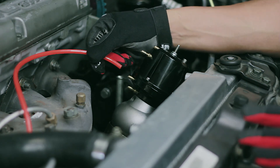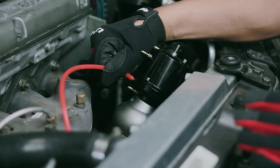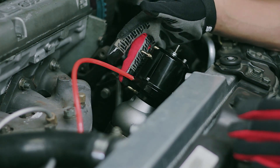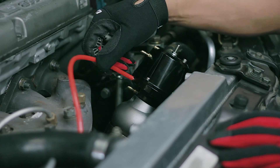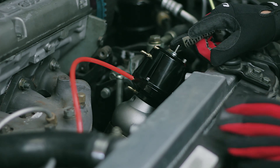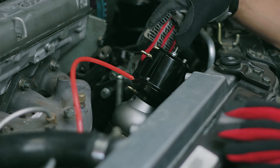The steps to achieve your target boost pressure on the synchronic wastegate without a boost controller: first, get close with a proper port combination. For example, if you're making 10 pounds on port C but you want to get to 11 or 11.5 pounds, apply boost to port C and then go to your preload adjuster and turn it clockwise to add more preload to the spring to reach your target.